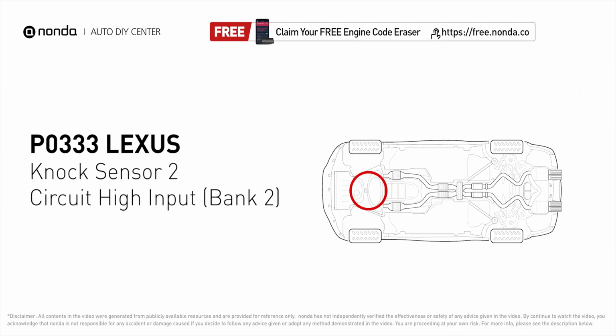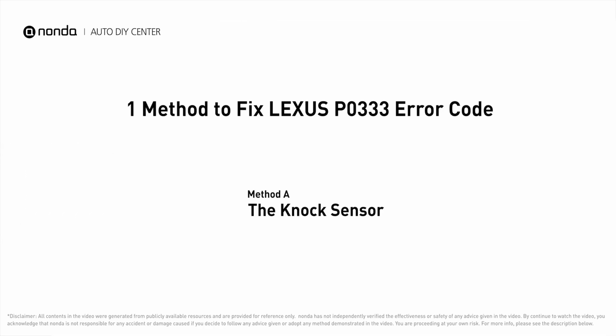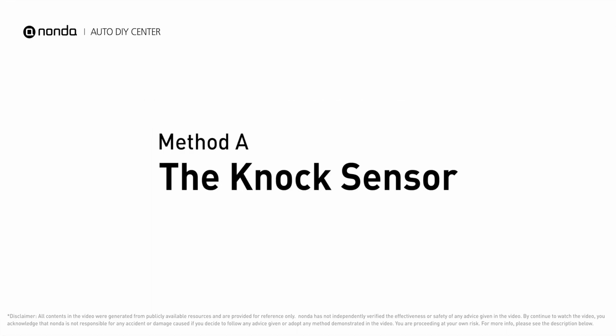It means that the input voltage from a knock sensor circuit in one of the cylinders on bank 2 is higher than the manufacturer's limitation. Here is one of the most practical solutions to fix Lexus's P0333 error code. Method A, the knock sensor.